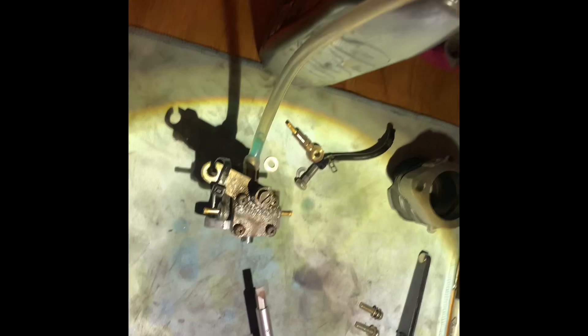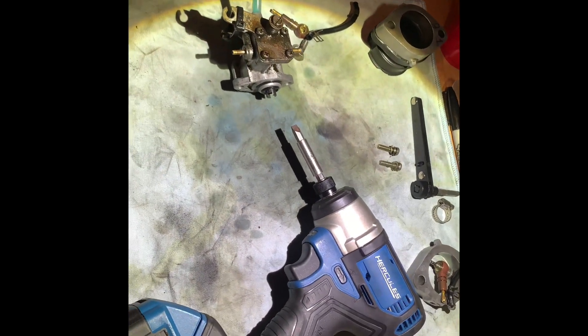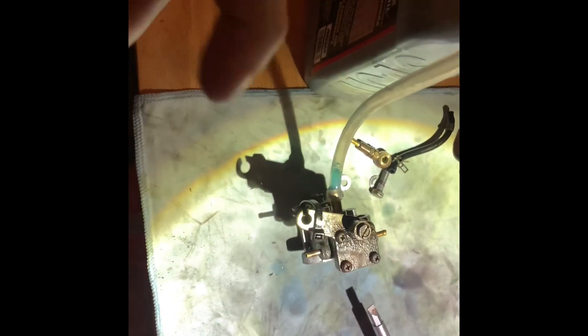I've got the oil pump set up for this priming and function test. First, there's a throttle cable connected to this — there are three different throttle cables, one goes to this and two go to the other carbs. You need to zip-tie this or somehow pull it up to allow full throttle, and then you're going to want to run a line from the oil tank feed line — put a tube right here, put some oil in it or just put it into the tank.